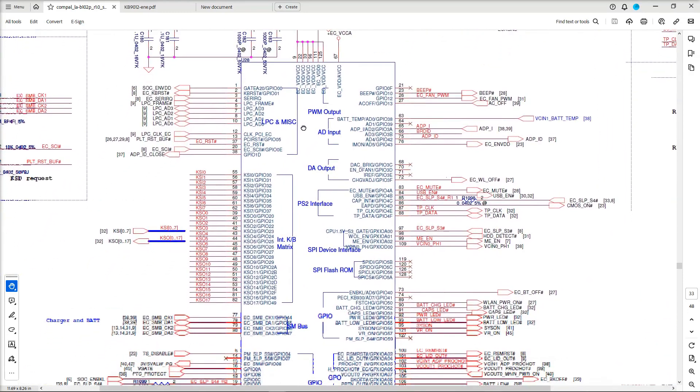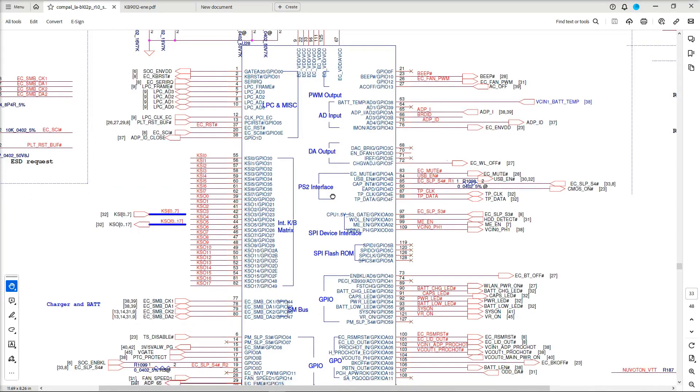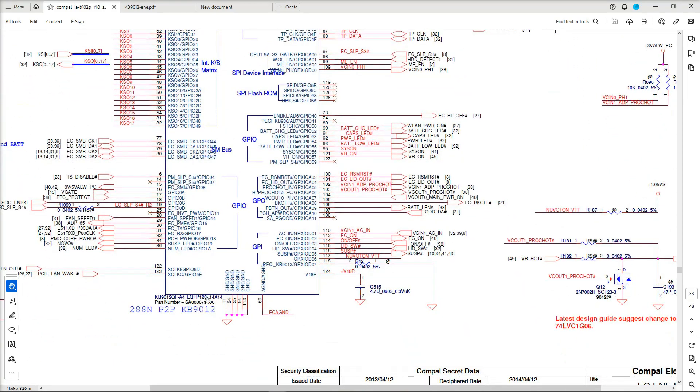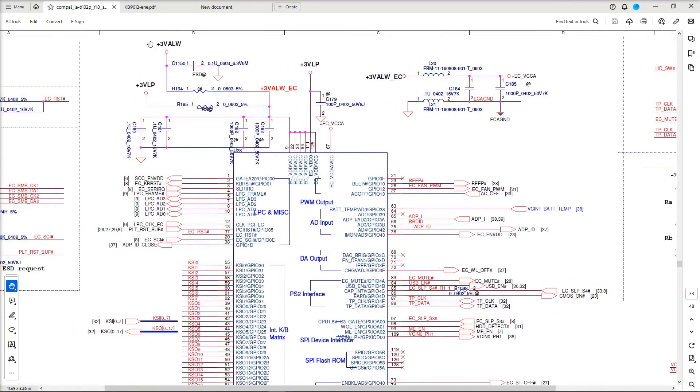I found where the Super I/O is referenced in the schematic. As you can see there are a lot of pins - 128 in total - so it's not feasible to check every single pin, but we're going to check some of the important ones. At the top we have our 3.3V always-on coming through a resistor to six separate pins where the voltage comes into this IC, so we're going to check those pins.